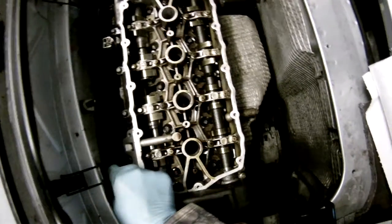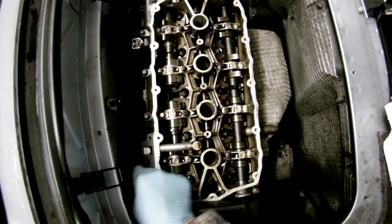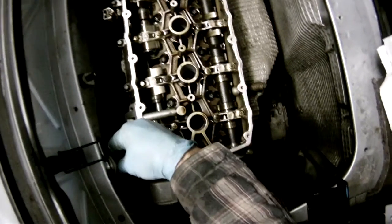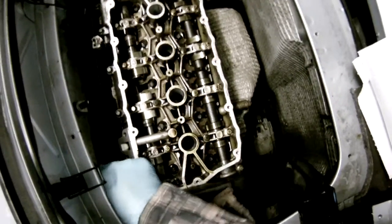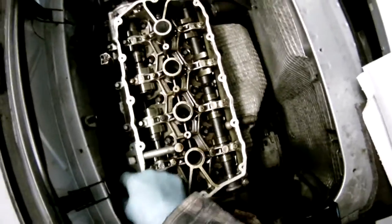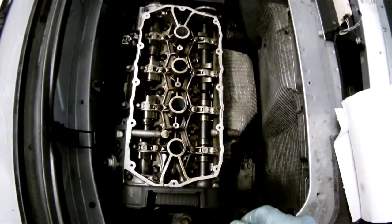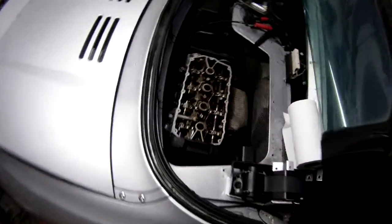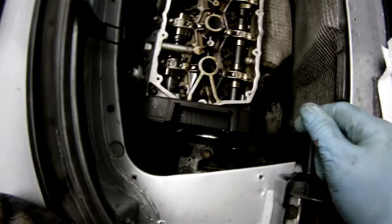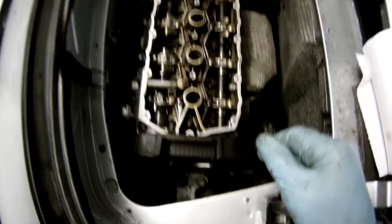So you can see it's not actually clamped or stuck as I thought previously. You can actually see the timing of the valves on the inlet side changing as you move it up and down. It should be possible to move with that sort of ease. To aid quick reassembly and get the timing back to where it was, I put little paint marks both on the belt and on the gears. Double check the timing versus the RAVE manual as well, of course, but having the marks on the belt and gears with a bit of paint makes it doubly easy.